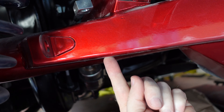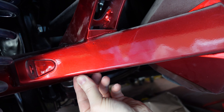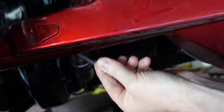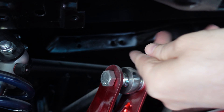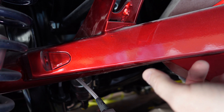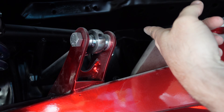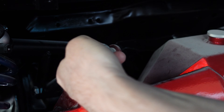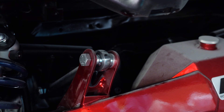So what do you all think about just sticking it right there? Does anyone think that's going to be an issue - just having this guy sit under here and bolted to it? There's plenty of travel on this guy both ways then. That fuel filter assembly is not going to be there - I'm going to move that up in here somewhere; I haven't decided yet. So that would be the easiest thing to do. Let me know what you think. I also have to check the exhaust - the exhaust is going to come up through this little opening right here, at least I hope so, because there's no other way it's going to work. They said it's designed to fit this four-link, so it's got to come in between here. Normally the Camaro exhaust would come through right here, but the four-link's in the way.